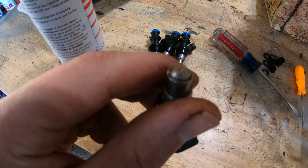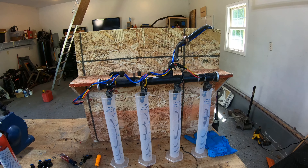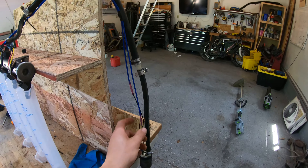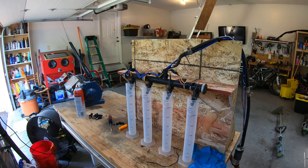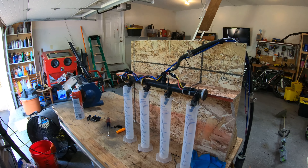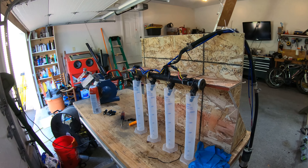I have all four decapped and ready to be flowed — open sprayer — and we'll see exactly how many pounds they flow, hopefully in the mid-70s. The stock ones are also ready. I'm just waiting on a fuel pressure gauge to make sure everything is set up. I'm going to put this pump in some fuel and power this thing up to see if the rig is functioning, then proceed to tests. Once testing is complete, I can install them in the truck. I also want to flow the injectors out of the Honda in case one is weird and needs replacing.